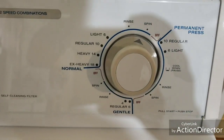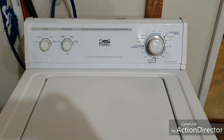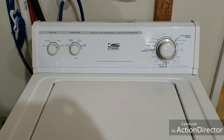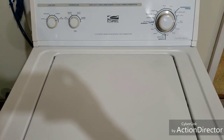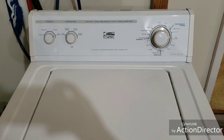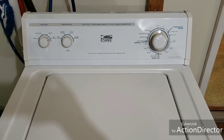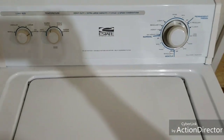Okay, and here we go — final spin cycle. It's spinning full blast, full speed here, you can see it sounds great. Nice and balanced, and I'm going to open the lid to show you that the lid switch works. It is spinning nice and fast, but typically you would never really want to do that. That's why those safety switches are in place — but you can see, nice fast stop there. This will spin out for about seven minutes or so, make sure those clothes are nice and light.